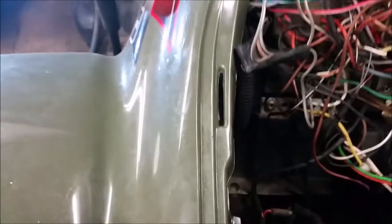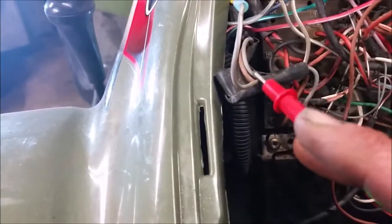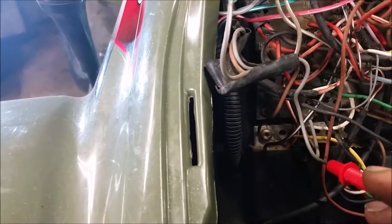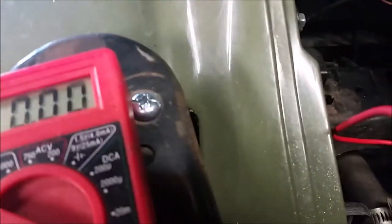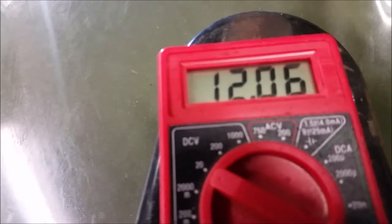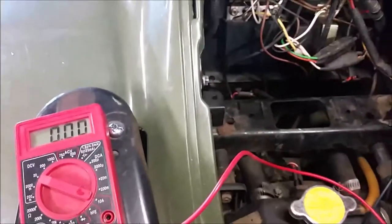The other wire is your gray wire, which goes to the four-wheel drive coils on the wheels. I'm going to touch one of these and see what we get — 12 volts on the right side. I also have 12 volts on the left side, so I've got power going to each coil at the hub. That's a good sign.